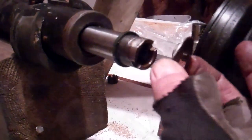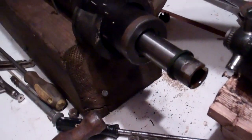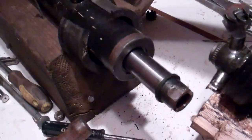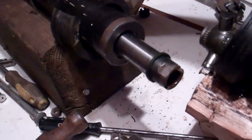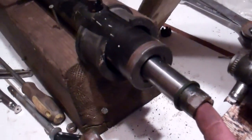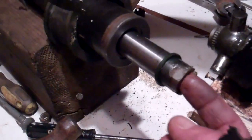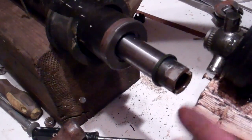Now, if we were doing this in the real world, I would follow my maintenance manual, which would advise cleaning off the steering shaft there and applying a light coat of power steering fluid to it — whatever your maintenance manual advises — and then putting a little locking compound in where the steering rod ball joint threads in there.